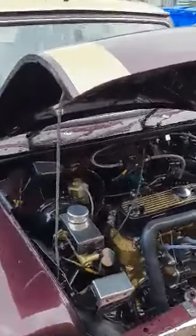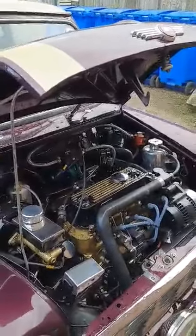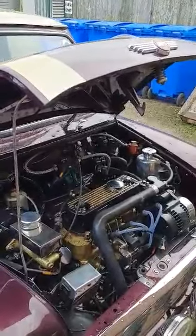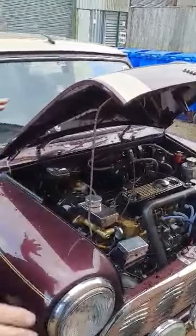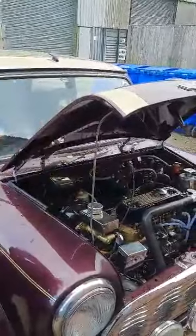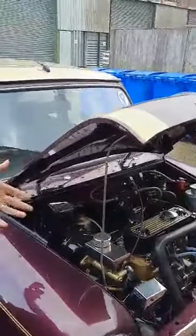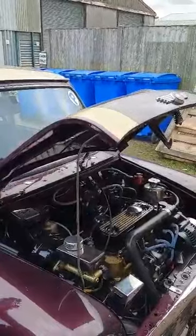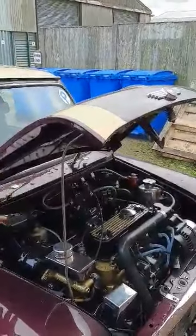It's all switched off now and we'll go for a start again. You can hear the ECU has got a hold of the ignition advance — that's without any throttle pedal — bringing the engine up to speed. Once it gets to temperature the engine will sit at about 1000 RPM. On lesser cam cars you can have them idle at 800–900 RPM. This is a difficult car because it's heavily tuned and has a catalyst.